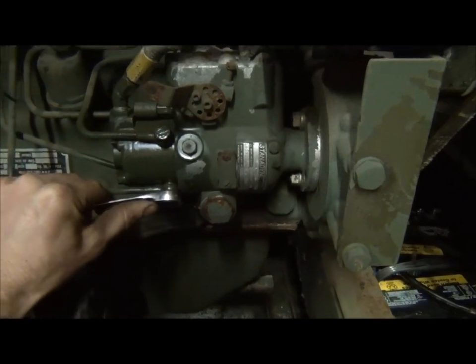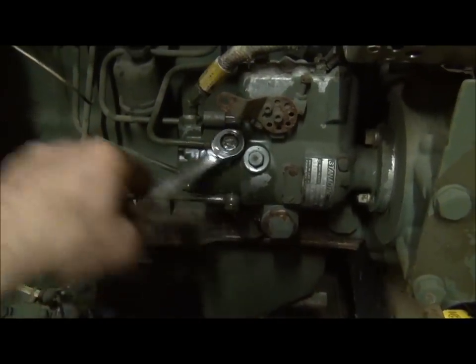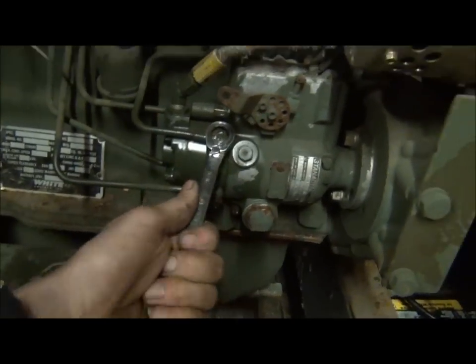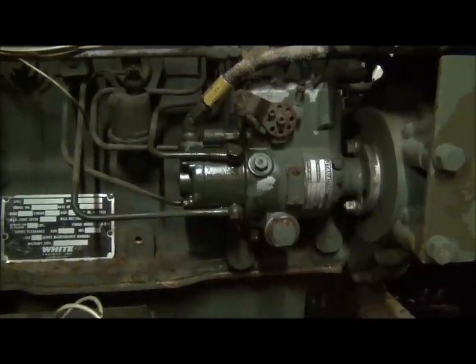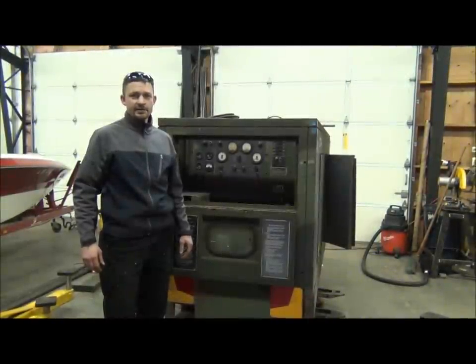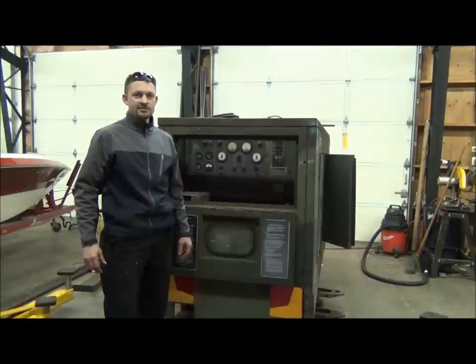Getting these two injector lines — that one is plenty tight, but this one is way loose. Hopefully it's not stripped out. I got it tightened up, but I should check that both copper washers are in place since this one was so loose. I'm going to pull that bolt all the way back off and double-check the copper washers, and at the same time tighten up the two lines on the back of the injection pump. I pulled the banjo bolt out and checked — both copper washers are in place, so I went ahead and replaced them anyway since I have plenty in stock. I don't know why that bolt was loose, but I'll definitely be keeping an eye on it.